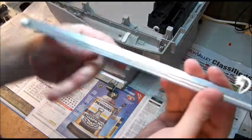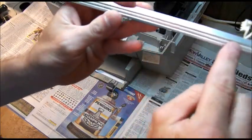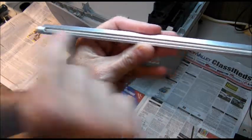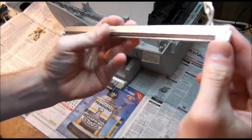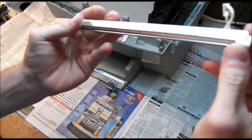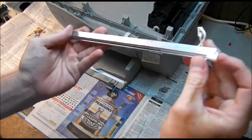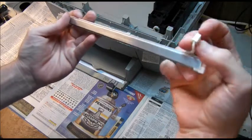So the bulb assembly is out now. Here is the bulb going right along here as you see. These little rubber caps have to be pulled out and then the new bulb has to be soldered on to the leads from the original.